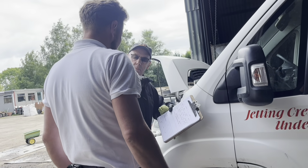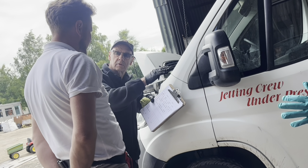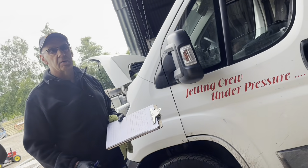The differential pressure sensor, so then it tells the ECU, right, we need to take the exhaust up to 600 degrees to clean the ash out. But if these little things load, you're not going to get out of that anyway. No. As much driving as you want to do, you're not going to get it out of limp mode. And I don't like driving.